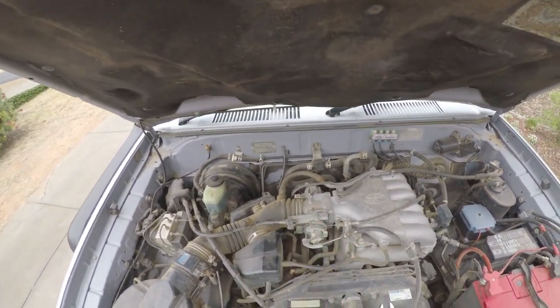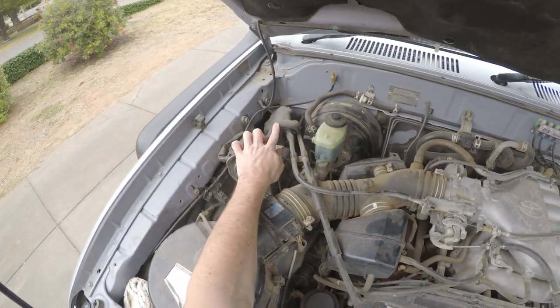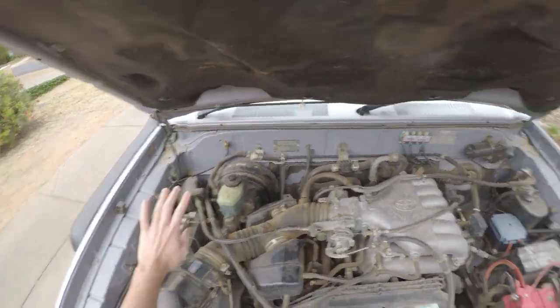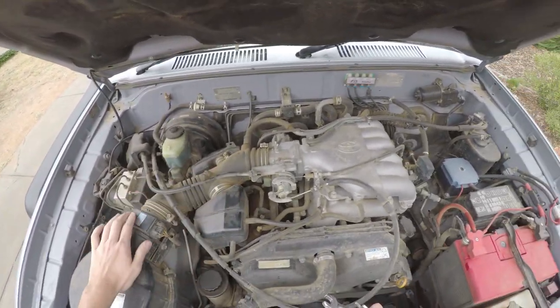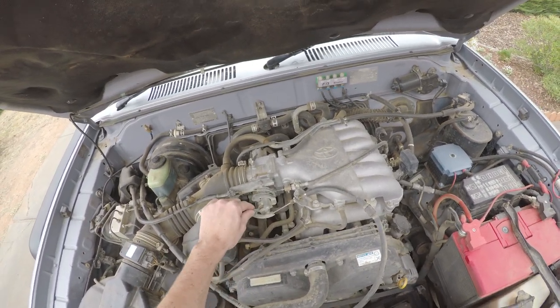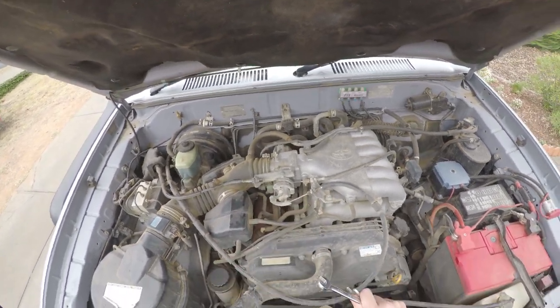All right. And that's it for the cruise control side of things. Obviously, in the cruise control box, you can pop that cover off too and adjust it in there so the lever's got no slack. I won't go into detail with that one because it's generally enough. Same with your kickdown. Just adjust it so there's no slack in it. Start up, make sure it's not over revving. If it is, you need to back off the cables.